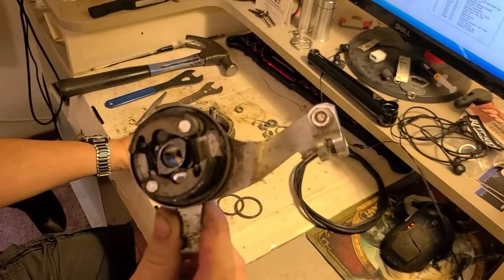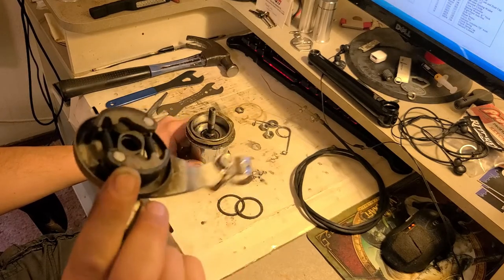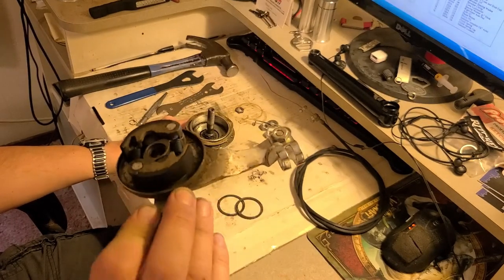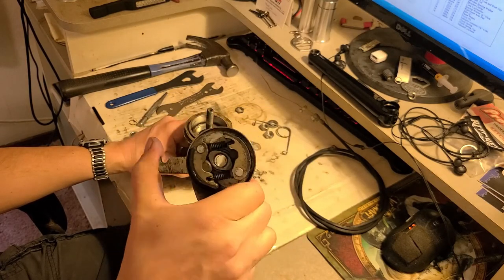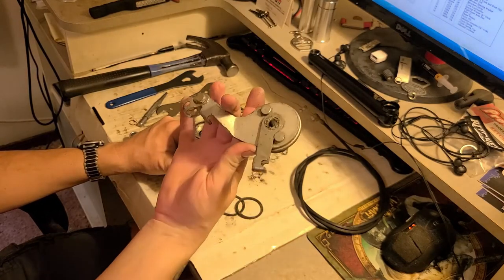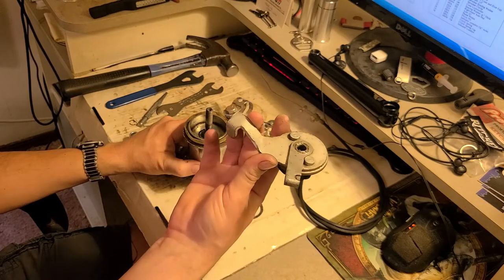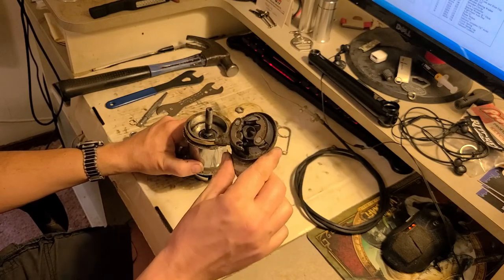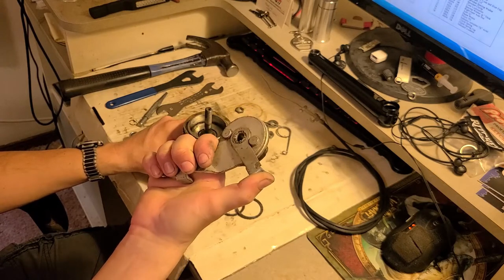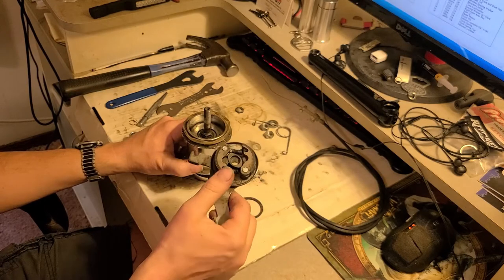I was thinking of putting this on my folding bike, but I'm looking at the rubber — if it's even considered rubber anymore — and I wonder if I could just glue new pieces of rubber on there, or find one of these in like-new condition. It's kind of cool — it's like a little tiny drum brake, you know, like for your car or your motorcycle. I was thinking maybe this hub can go on my Speed Uno — it doesn't have rear brake mounts, but it does have a coaster brake arm mount, and this seems to be the right distance. There are also AB-style hubs with a 70-millimeter brake where you can buy the whole assembly if it wears out.